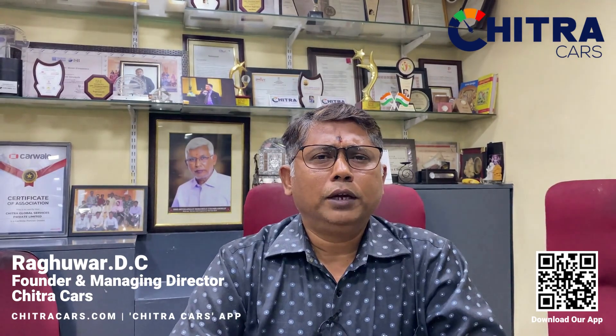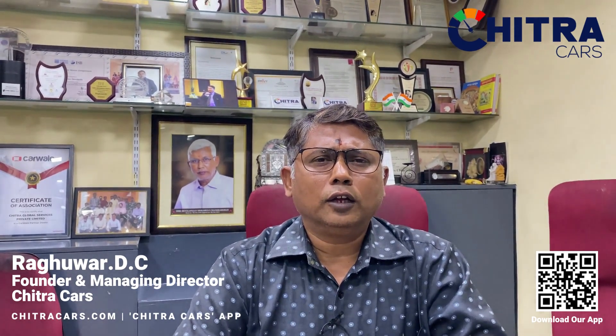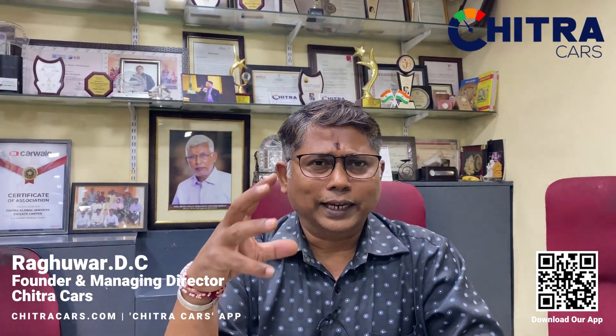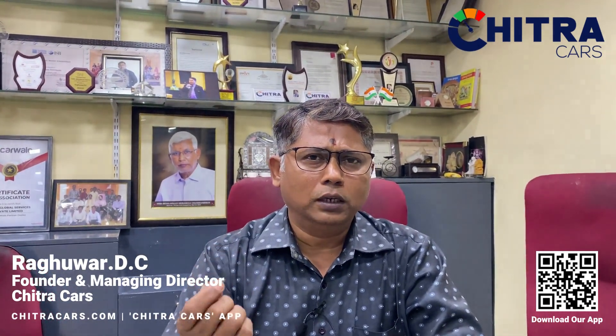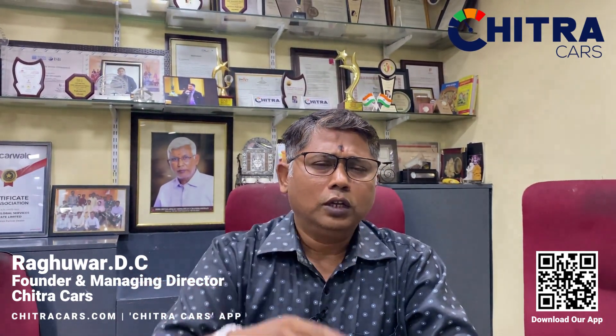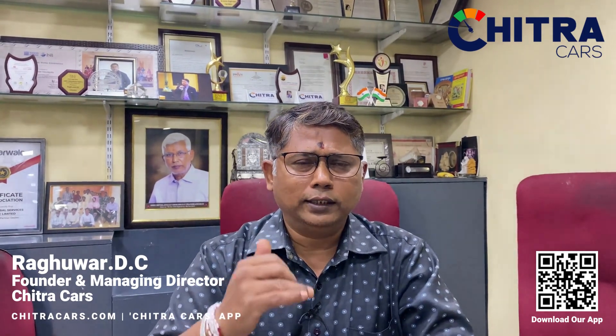Next, make sure that you check your tires. To check how much groove is available, take a coin and put it in the groove. If it is more than 50% you are safe for the monsoon. Tires play a major role in grip — when you brake, if the tires are worn off, you skid and there are chances of an accident.